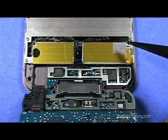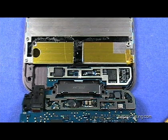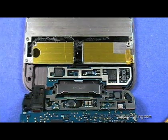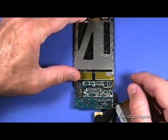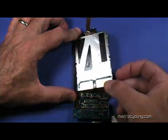The four remaining screws attaching the display should be removed as well. Use the small flathead screwdriver to carefully pry up the board shown here. Once the screws are removed, the display can be lifted up and away.